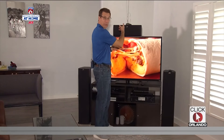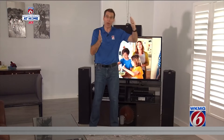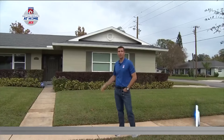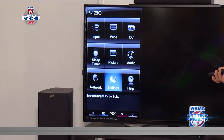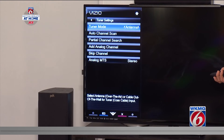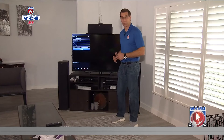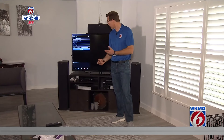There are different levels of antenna — this one we got at Ace for $15.99. But depending on how far away you are from the News 6 towers in Ocala and East Orange County, you may want to buy a bigger, badder one. Some people put antennas in their attics, some put them on their roof. Last thing: go to your settings, make sure your tuner input is set to antenna, and then do an auto-channel scan so it searches for and stores all of the available over-the-air channels.